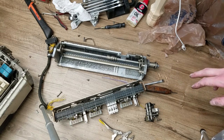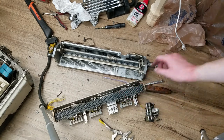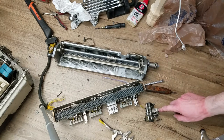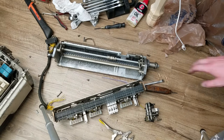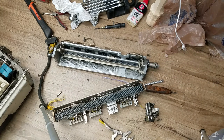That's why I felt comfortable taking this out - when I realized it has that clutch, I knew it couldn't be timed to anything else in the machine because the clutch can be engaged at any point, so there would be no timing relation. Additionally, someone did misalign it and this whole thing was seized up. When I was turning it over by hand, there was a stiff part and then I clicked past - I think that was this tab clicking past this relay stop, because it was so seized that the solenoid wasn't able to release the clutch. So turning the belt manually forced the whole thing to keep going and push right past the stop.